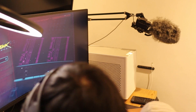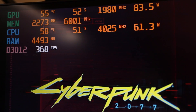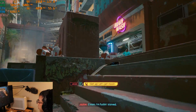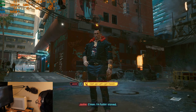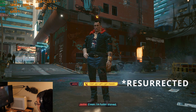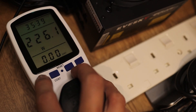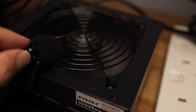We're drawing 206W from the wall. I'm going to put the overlays on. Right in the menu, the GPU is drawing about 85 watts and CPU about 60, which is about right for the recommended TDP of the Ryzen 5 3600. Currently drawing around 226 watts from the wall. In terms of overall stats, we've got a low of 3.8 watts and a high of 251.5 watts. So far while gaming, I didn't notice any weird shutdowns, which is really a pleasant surprise and indicates this power supply is well-equipped. Of course, we wouldn't know unless we sit with it long enough, but on initial impression it seems to work just fine.